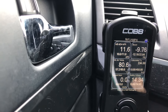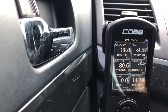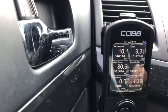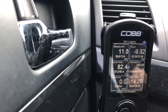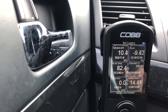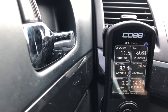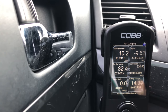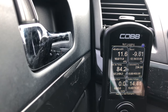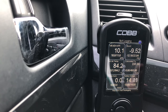At 22 PSI — I don't know — maybe it's because the electronic boost control solenoid has three ports and controls boost better, giving a more accurate reading. But to me this feels like the power is spread throughout the RPM range, whereas before the turbo would just kick in hard all at once. This feels like a steady, progressive power delivery, if you can understand what I'm saying. I'm definitely not keeping the off-the-shelf map very long.